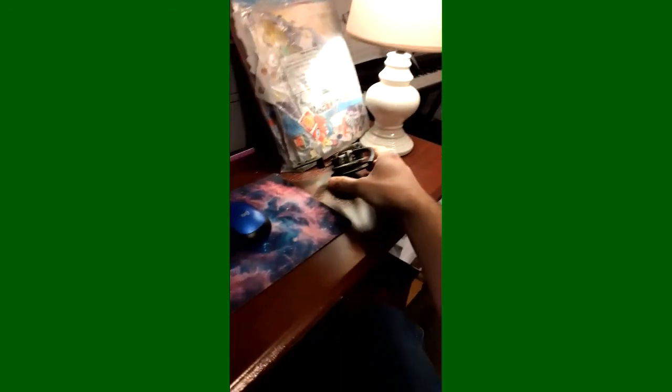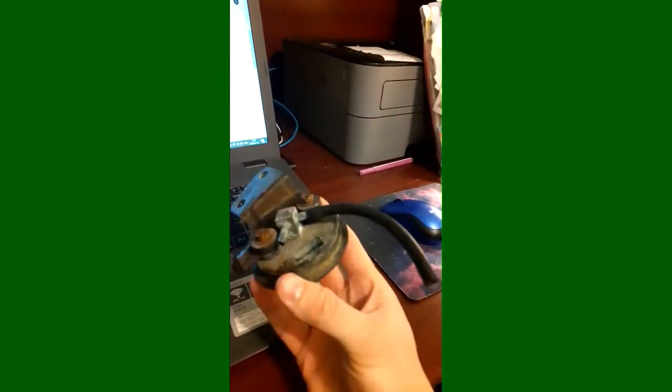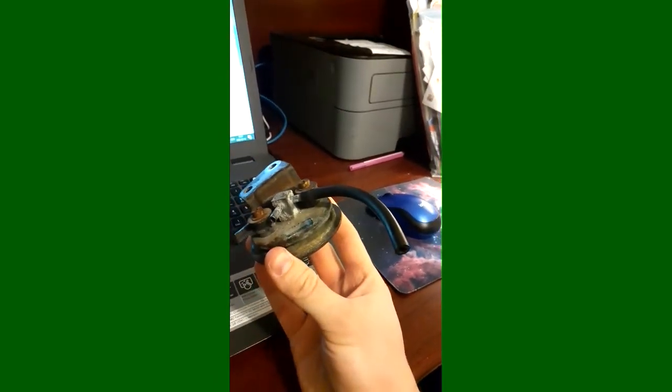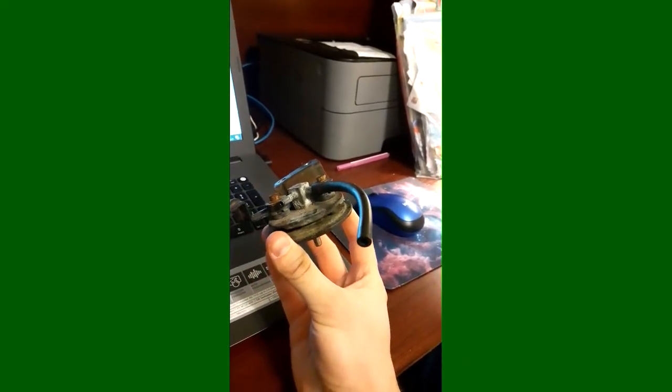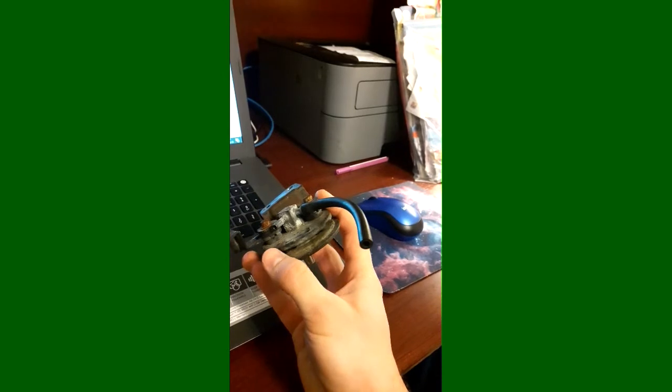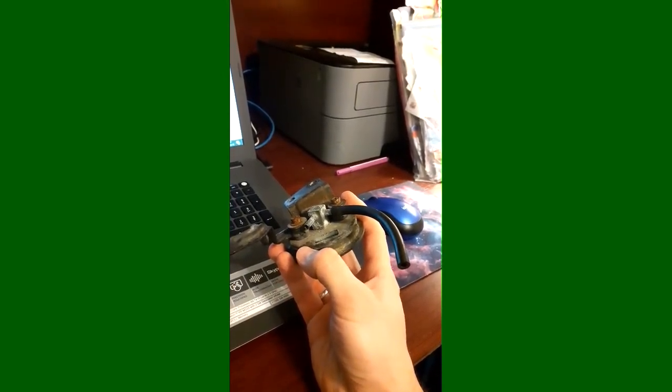There's really no good video online for a Nissan back pressure transducer. This is off of a 1993 Nissan 240SX — this is the back pressure transducer for the EGR. What happens is vacuum from the manifold is routed to the EGR solenoid vacuum solenoid.